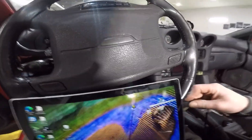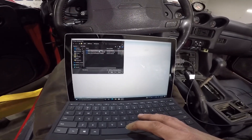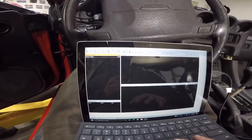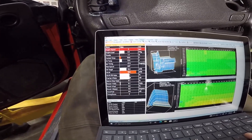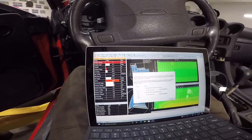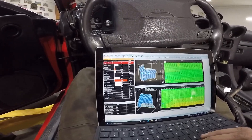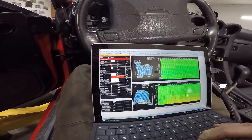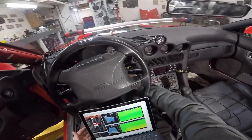Plug your ECU into your laptop, turn your key on, go to AEM Tuner, go to your Series 2 workspace. Don't want to open up a map — come over here to ECU connect. Looks like my throttle is still good. What you'd normally want to do is go up to Wizard, set throttle range — hit set low voltage when your foot's not on the throttle, then floor it and hit set high voltage. Everything seems to be working. I'm going to go to Wizard and sync ignition timing but I'll have to wait until the car's running. Adrian's here to help me check for leaks. I had good oil pressure when I was just cranking it — clutch in, let's crank this thing.